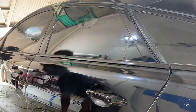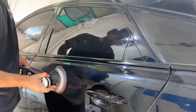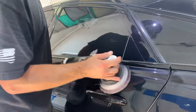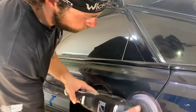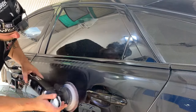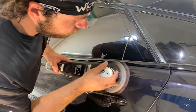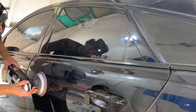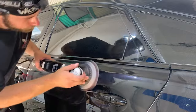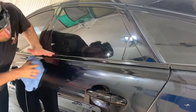This is an old trick used by older detailers and also used with diminishing abrasive polishes and compounds like Shine Supply. My pad had no compound on it but there was still compound on the door — I just spritzed my pad with water, which can help finish down Shine Supply Classic Cut. Back in the day the trick was to do the same with Meguiar's M205, or to use a watered-down M205: put two or three ounces of 205 in a spray bottle with water and use that to final polish. That's a trick for jet black finishes like the NSX.